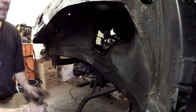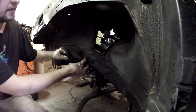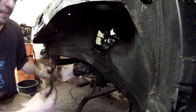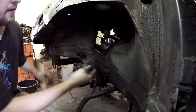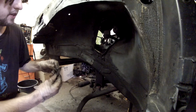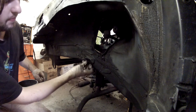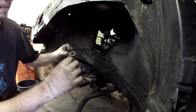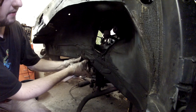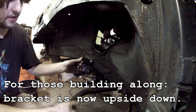One of the first parts that needs to be replaced is the front brake line brackets. The stock ones look like this, but if you add the GTI suspension with the drop link for the anti-roll bars mounted to the strut, the mount won't clear and it will hit. To fix this, the bracket needs to be moved a bit. You could custom make this by cutting it in half and welding it back on, but there's a better method — the 106 and Saxo cars actually come with exactly the right bracket as standard. The only modification needed is that the hook that hooks into the frame on those cars needs to be flattened out with a hammer to become a bolt hole, and it works perfectly.